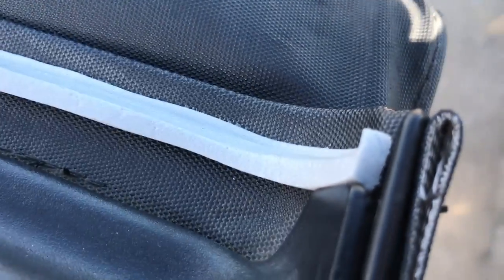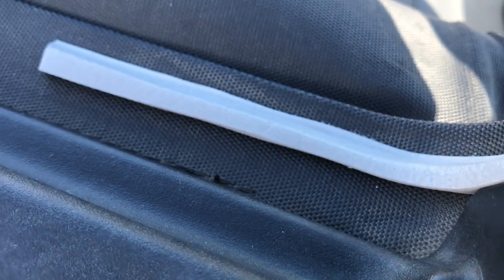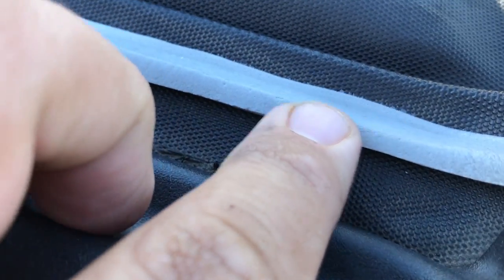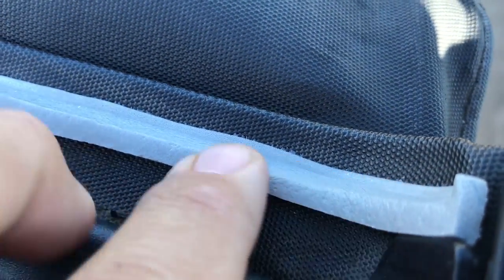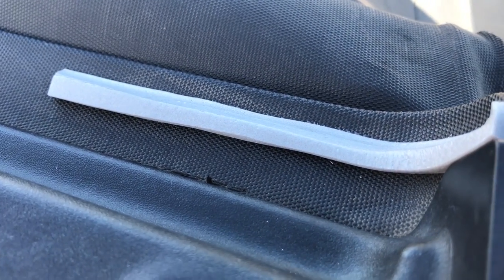So just simply putting this right here at the edge of the plastic toward the header, down around, doing this on both sides, and then about 4 or 5 inches across the center, you can see this has been closed up for a while now. But you can see where it's pressed into the rubber channel. Sorry for that little camera flip around. It presses in right here, and just that little bit is all it takes to stop that leak. And it has worked well for me.